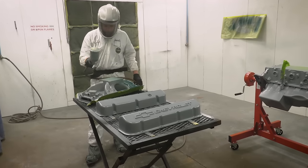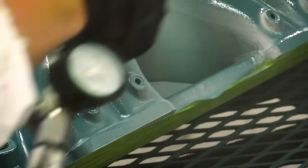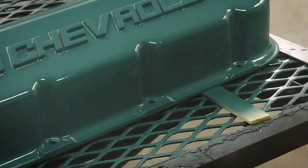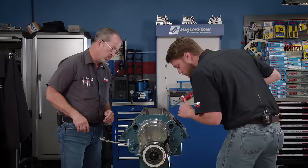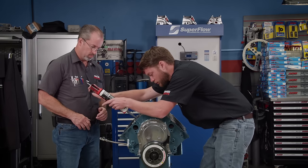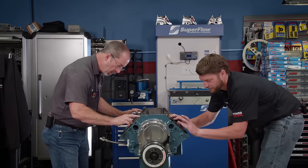After cleaning the gun, we load it with the thinned POR15 engine enamel in the Buick Green Turquoise — a color unique but still from the GM family. Laying the paint down in several coats gives that smooth, glossy finish we love. Now that the engine enamel is fully dried, we return to assembly. A small amount of silicone goes at the top of the deck surfaces to prevent oil seepage, and the Cometic 4.320-bore, 27-thousandths-thick MLS head gaskets are laid into place.